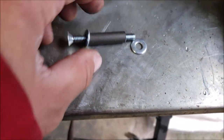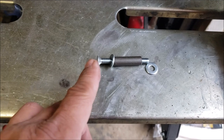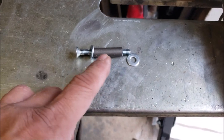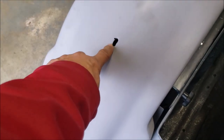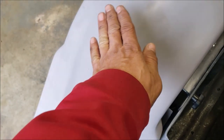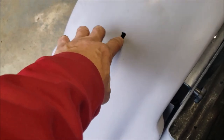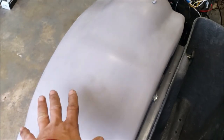I figure I'd have it flared out a little bit more. The fender will sit on top of this one — I'll weld it in place there and then whatever I put on the outside will go on that. I haven't decided what I'm going to do on the outside yet. It might be something decorative that actually threads down onto it. It's going to be behind the back of the seat so it will be visible. I had to play with the whole location — I can go back and fill the hole because the riv nut ended up angled due to the curvature of the OEM fender.